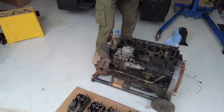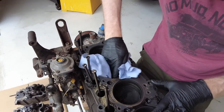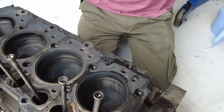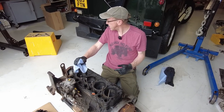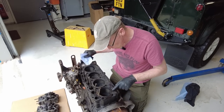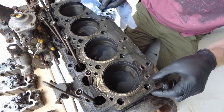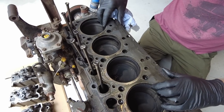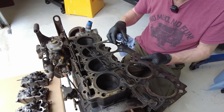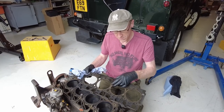That's probably good enough to use — I'll clean it up. That's the best we've had so far. Let's have a look at what the bores and pistons are looking like. I think I need to give them a proper clean but I can't feel any major issues — we'll probably need to deglaze them. I bought myself an engine stand so we'll spin it round, take the sump off, and have a look. Interestingly, this one has a one-piece head gasket rather than the four individual ones — that's interesting, I haven't seen that before. Seems a better idea — whether that's an upgrade or a standard feature on the 2.5, I don't know.